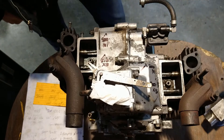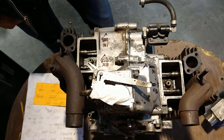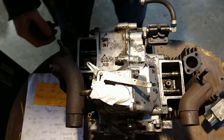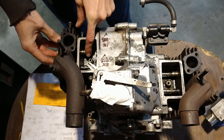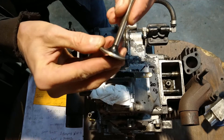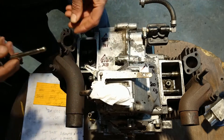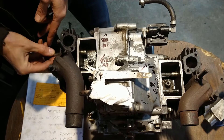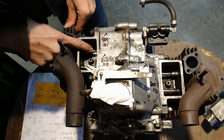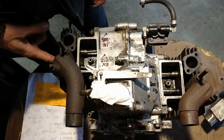We're back on the M18 and it's been a while. What we're going to do now is prepare the valves for reassembly. In previous videos you've seen where we lapped the valves, and what that's going to do is change the clearance between the lifter and the valve, because we're basically changing the seat a little bit.